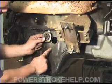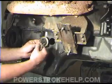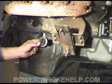It'll swell, and it'll start to seat down the side. The crankshaft is on the inside, constantly flinging oil on this thing, and when the O-ring fails, it just pours down the side of the engine there.